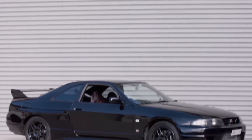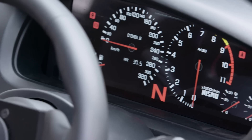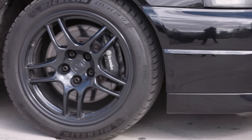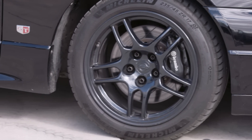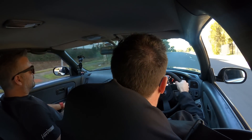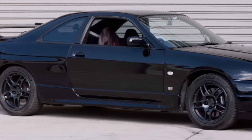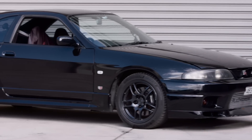The second car is an R33 GTR with a much bigger turbo, making around just over 1,000 horsepower. Power delivery is totally different — almost instantaneous — and it's got a sequential gearbox. That car is not really one you can pedal very easily; it essentially breaks out into wheelspin and will sit at 9,500 RPM banging away at the limiter. It's a really good example of a car that's very, very undriveable in terms of traction. So we'll take it out in two-wheel drive first to show just how violent it is, then show we can actually control it.